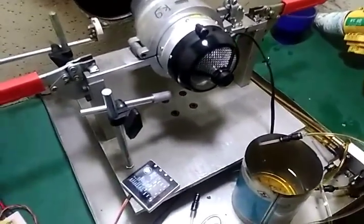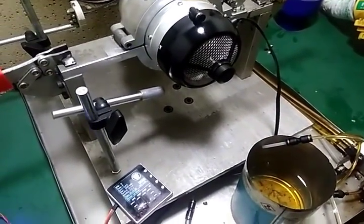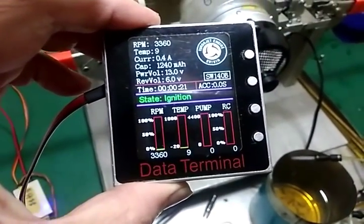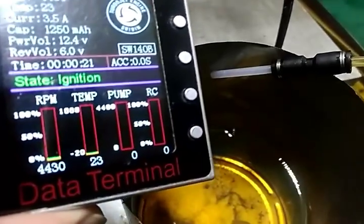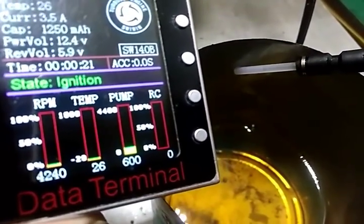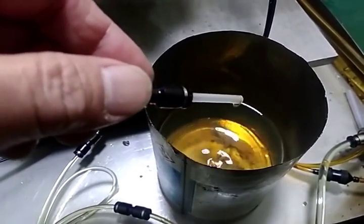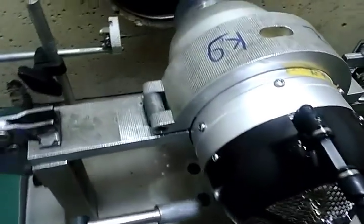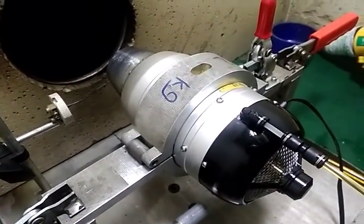So what is the suitable fuel supply for ignition? Let's do a sample — we are starting the engine now. It will take 8 seconds to warm up the glow plug. The pump is running just a little now, and now it starts pumping. This is a suitable fuel supply. You can hear the sound is different now — the engine will start up smoothly.